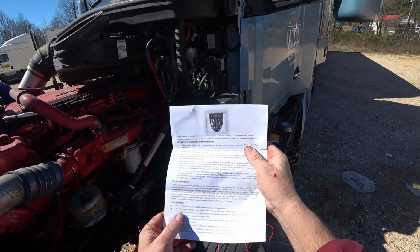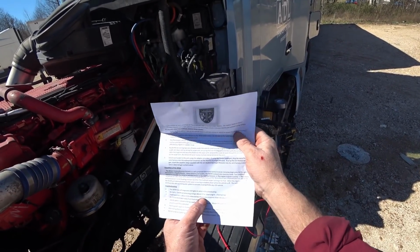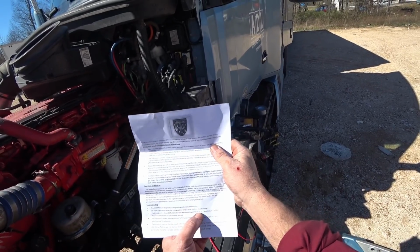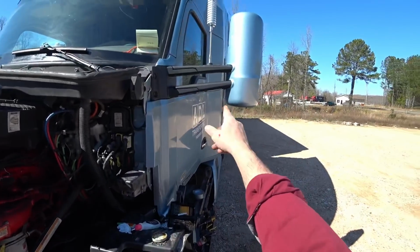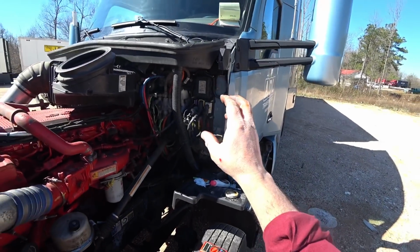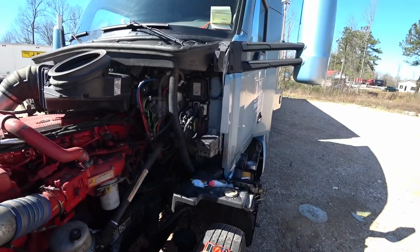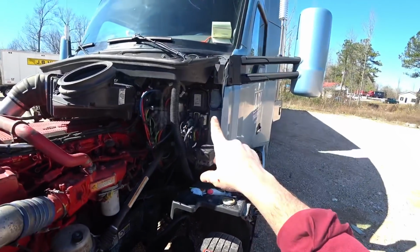I looked in the instructions, under troubleshooting. It says flashing green: above 13.5 volts detected, but the thermistor, I'll take the thermometer, is warmer than plus 4 Celsius, 39 degrees Fahrenheit. So that just means it's warmer than 39 degrees out here, so it's not going to be on, but it's receiving power. None of the red lights are on. Everything should be good. It's just saying everything's good, but it's too warm for them to work. When it gets below 38 degrees, then it will be steady green.